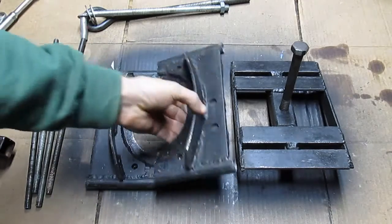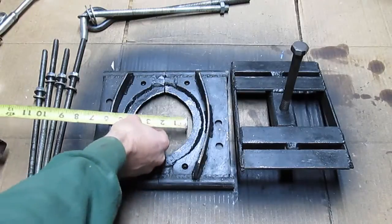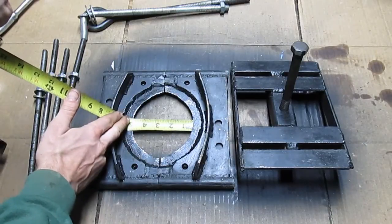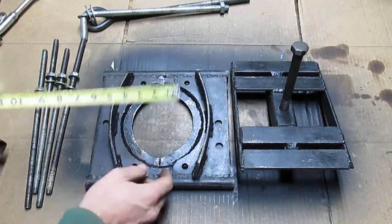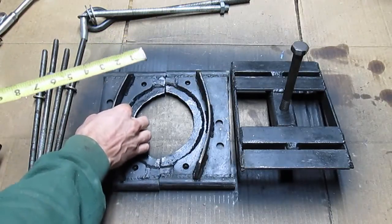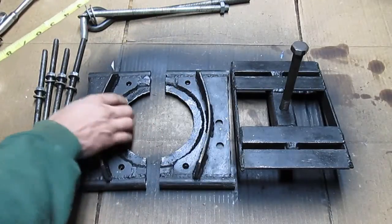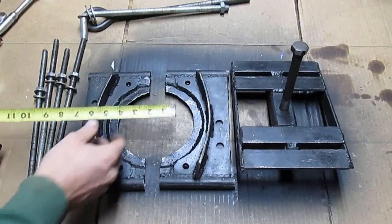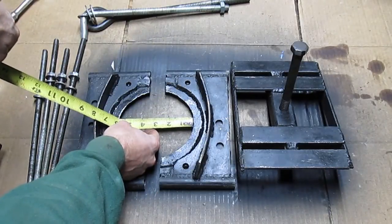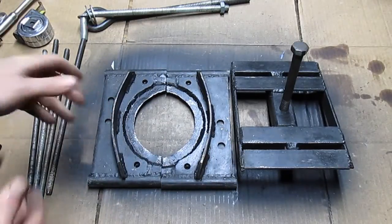Those are pretty simple. When they're together, the distance between here and here — the diameter, I guess — is approximately 4 5/8. But as you can see it's oval, because the true diameter of the hole I drilled is approximately 5 1/2 to 5 3/4, something like that. The reason we did this is so we can clamp a wider arrangement of gears.